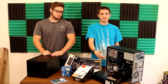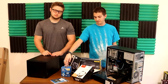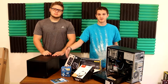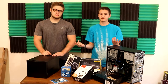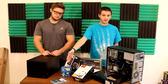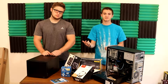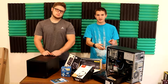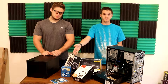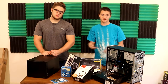Right now I've got an AMD processor in there, but I'm actually switching to an Intel Xeon, which is made more for workstations and 24/7 use compared to an i3, i5, or i7, which are more gaming-oriented. My RAM is also ECC RAM — error correcting RAM — so if a drive has a bad spot, that RAM will actually go and try to correct it instead of normal RAM that just ignores it.